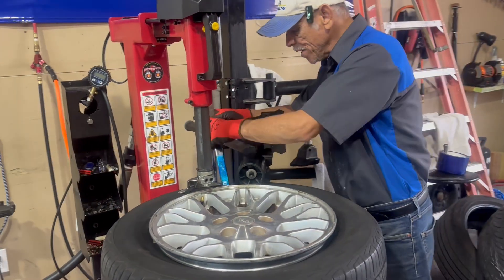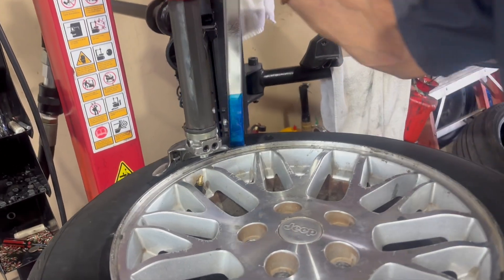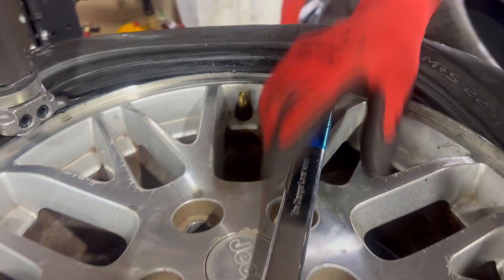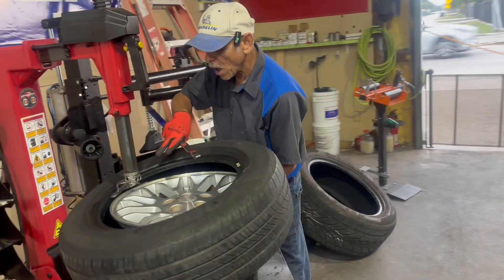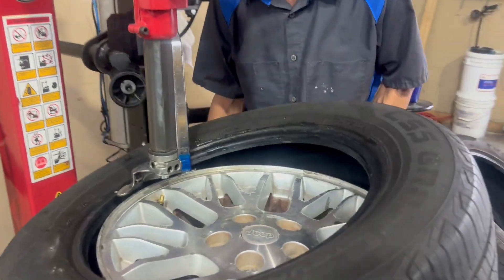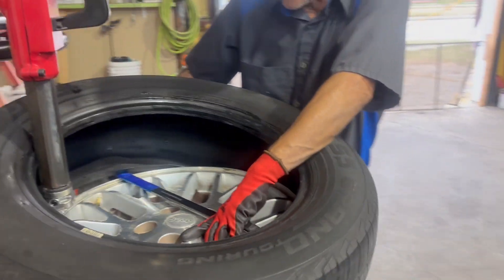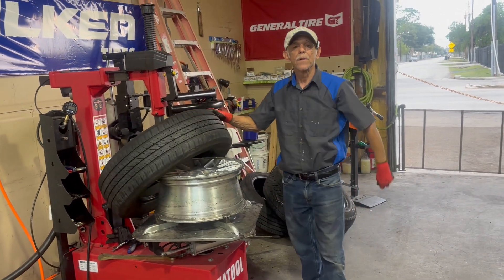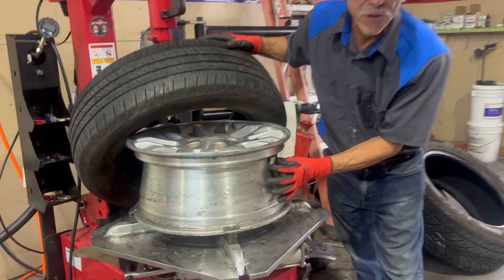I'm going to set the bar in here, bring up your roller, bring it back. You want to bring the valve stem back under the head. Help the tire just a little bit — and there it is. The tire dismounted without destroying or damaging the sensor.